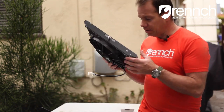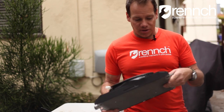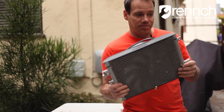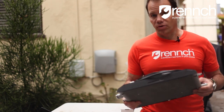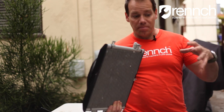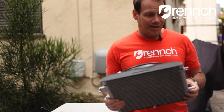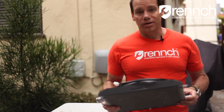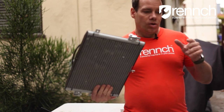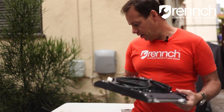Second, and this is gonna be the kicker, is the fan and condenser. This is the thing I'm gonna need to make some custom brackets for. This again is designed to be in the front of the short hood cars, like the 74 to 89. But since my car has a metal battery box in the way, I can't just mount this there. And I thought I could get away with it because I have RSR flares, so my flare is a little wider on this car. No chance. So we're gonna look at the front components and then I'm gonna take you guys to the back and see where we fit.